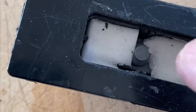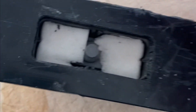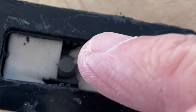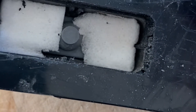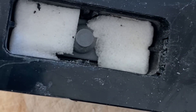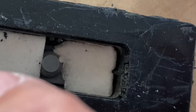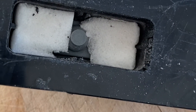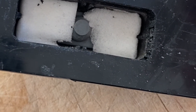I wanted to be able to push down on this button evenly, so I had to devise something. I took a paint stick, cut it up, made a couple of notches for these little slots on either side, and glued them together so it sticks up above but doesn't wobble within. Then I cut up one of those Mr. Clean eraser sponges, which didn't have a lot of body to it, and put it in there to give it a little more support without too much resistance.